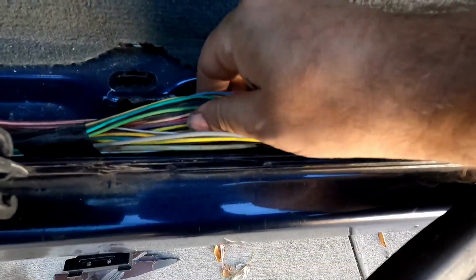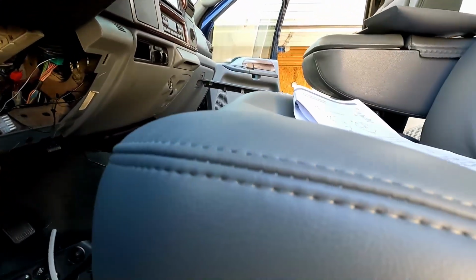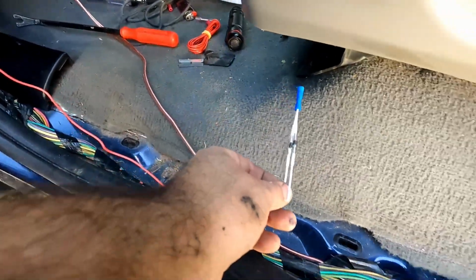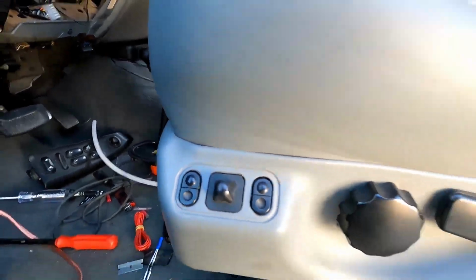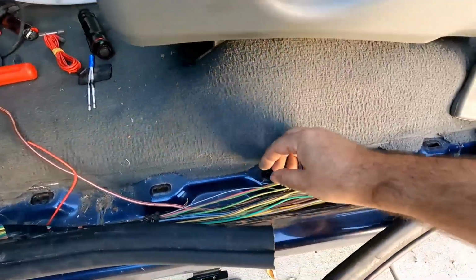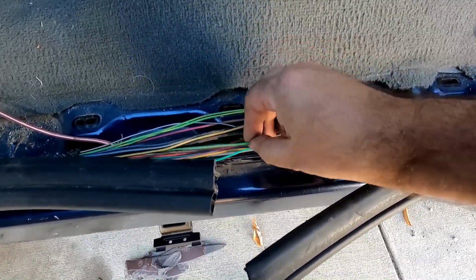All right, well, somewhere in here there's a light gray and yellow wire. Hopefully. I connect this wire to the black and yellow, then one end to the diode, then the other end of the diode is going to go to the gray and yellow, and then the top of the diode will go to the purple wire that I still have to push through. So let me get that all sorted. Correction, that is not light gray, it's light green with yellow. And guess what? There's a light green with a yellow stripe right next to a light green with a yellow stripe. Guess that's just a light green.